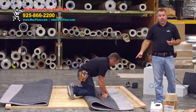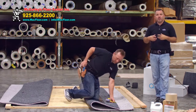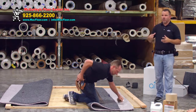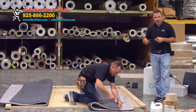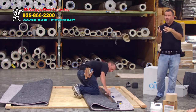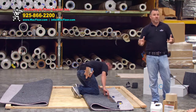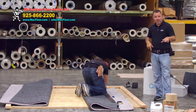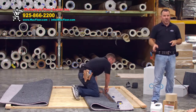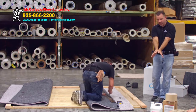The straight edge he's using is a two-meter roll-up straight edge — it packs easily. You are straight edging through an attached cushion product. The Aero product has a 3/8-inch, 32-ounce needle-punch polyester pad, so you're cutting through 3/8 inch of material. Use a normal razor blade with a regular groove straight edge. Because the straight edge raises the knife so high, you'll have to make two passes: the first to cut through the primary and come through the latex, the second to come back through to make sure you don't shorten the yarns.